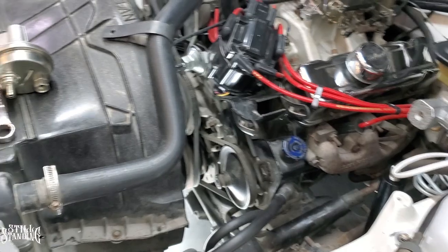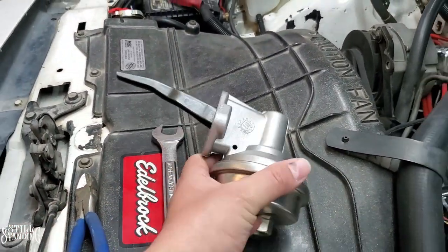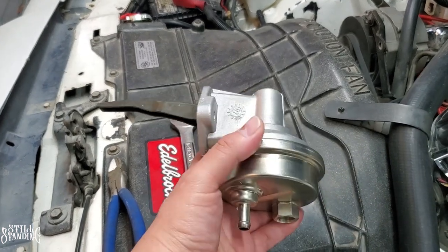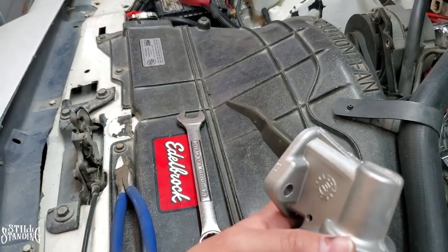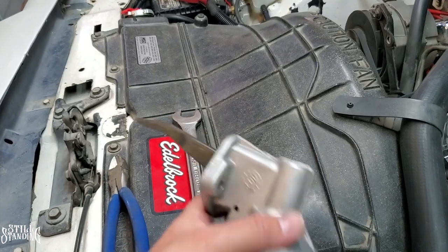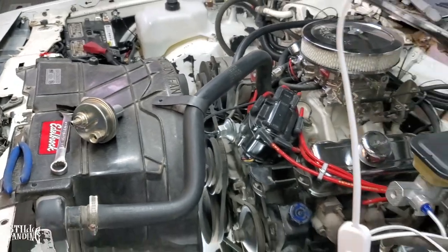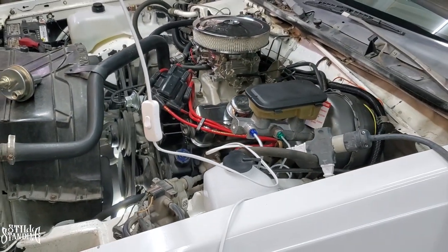It's a better view. Another thing is that these fuel pumps, they don't ride on a rod like the 350s or the other small block engines. So this one, you could just pop out the old one, pop in the new one. Supposedly, we'll find out. It always sounds easier than how it's done.